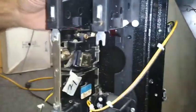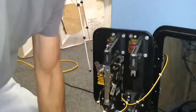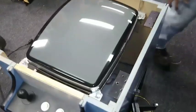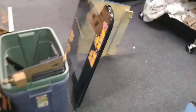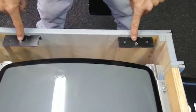That's the actual coin mech right there. Pay attention to this so you know how to take these out, because these are going to be your main failure points. If you get a coin jam or something, it'll be these mechs themselves. You see these — I got the top piece off. Those wing nuts, when you reach in the door — the studs come down through here and you lock them in right up underneath. You've got to tighten them up by hand.